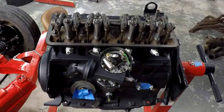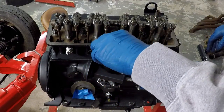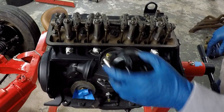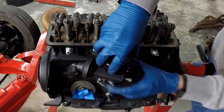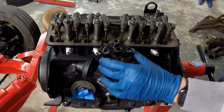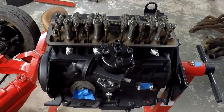Put the cap on. The cap has a very small little nib in it that you kind of lock in there — it's sometimes not easy to find, but it is directional. I'm double-checking to find it; sometimes it doesn't fit real well. I'll get that locked in, clip the cap on. Even though I've obviously still got a lot of work to do, just to make it look pretty and give you kind of the finished product. Now obviously I haven't set any distributor timing yet — it's still free to rotate until I tighten that bracket up — but that's what it should look like when you're done.